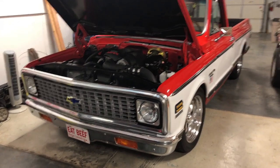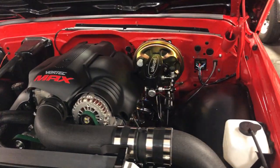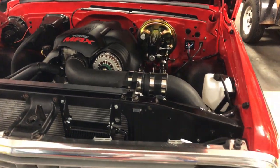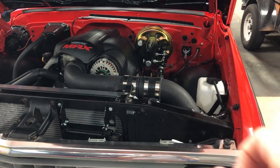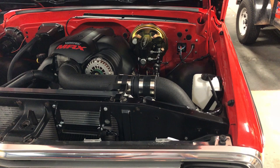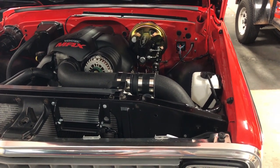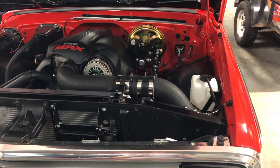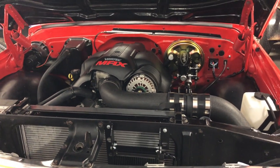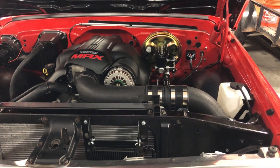We're going to start with the American Auto Wire body harness — I'll link that down in the description to the kit I bought. Great kit. One big caveat: the crimpers. These are a Packard 56 series terminal. Buy the crimpers. Either buy them, rent them — American Auto Wire rents them for about 20 bucks for 30 days — or borrow them. I was fortunate; I had a buddy that had them. You can buy some of the knockoffs and they work, kind of, but these are the correct crimpers for these terminal types.